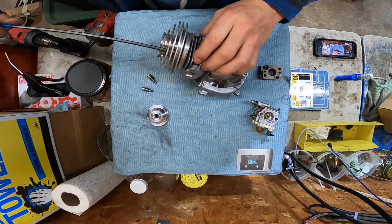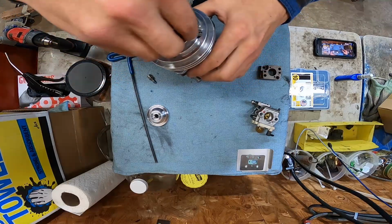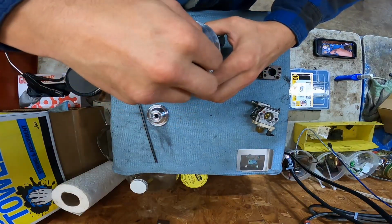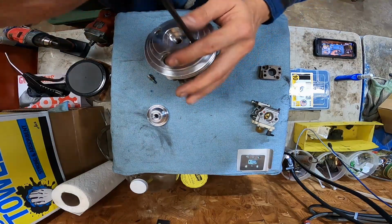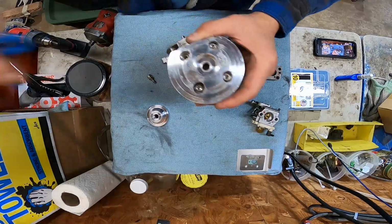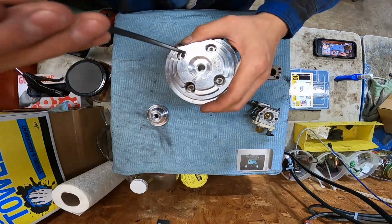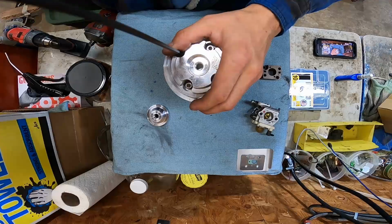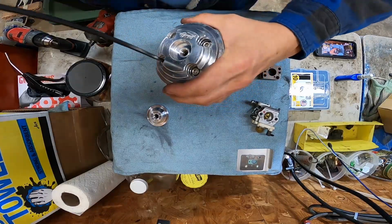You really don't need to use lock washers at all. You just really need flat washers. Lock washers have been proven to do literally nothing. There's guys who do torque tests where they torque a bolt to a certain spec, then try to loosen it, and then they torque one without the lock washer and use just a flat washer. And from what I have seen on the interwebs, the amount of torque to loosen it with just a flat washer is exactly the same as with a lock washer.